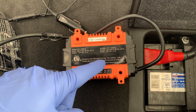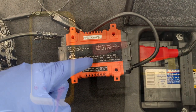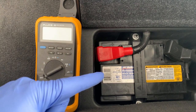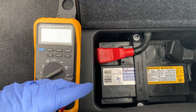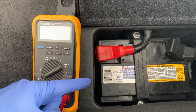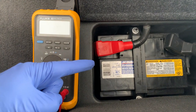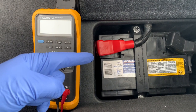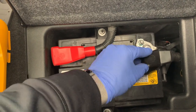Before I go ahead and plug this in for the winter, I'm going to conduct a couple of simple tests with my multimeter to make sure the battery is in good state. Due to the way the battery discharges, it's important to test the battery after it's been sitting for at least an hour to get the resting voltage. Or just turn the headlights on for 2 minutes to get rid of any surface charge the battery may have, with your car turned off. Also, make sure your battery terminals are tight and clean.